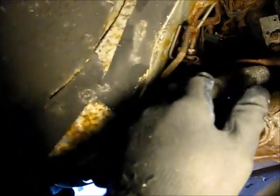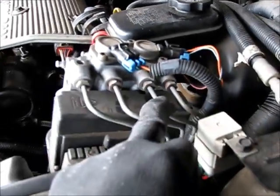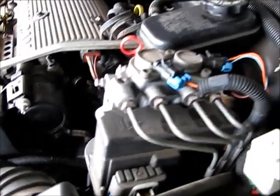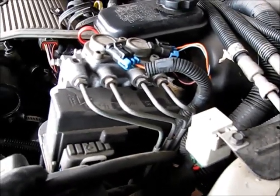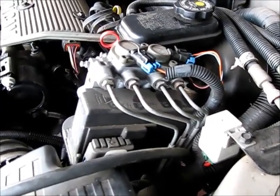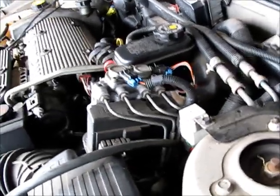And there is, in addition, another steel line that actually connects to the back of the brake drum. I measured this section out — it's about three feet long from the hose here. What I want to try to do is remove it at this hose and replace the line going all the way back up to the module — the ABS control module. We're basically going to leave the brake line intact, cut it out at both ends, run new line routed slightly differently. About nine feet of line from front to back, done probably in three pieces.